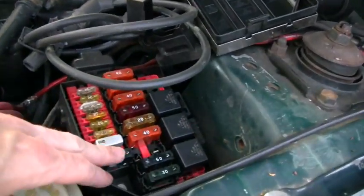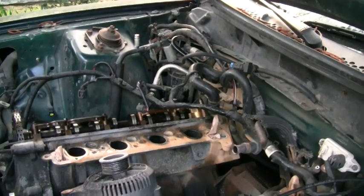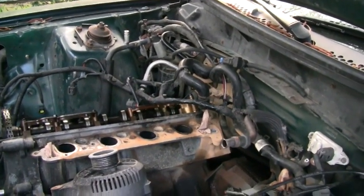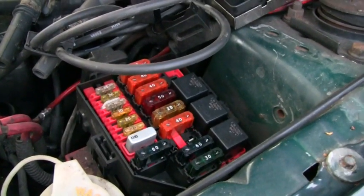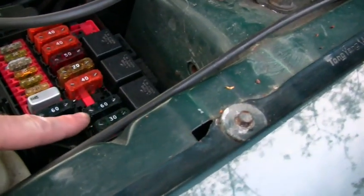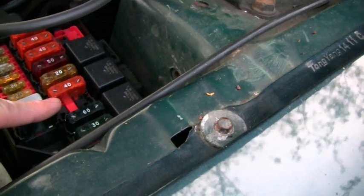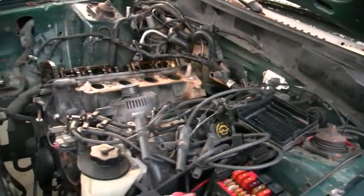The thing I've got to do is pull out the fuse for my fuel pump, because in pulling out the manifold I also disconnected the fuel lines. So if I were to leave that fuse in there, as soon as I turn the ignition on, fuel would come shooting out of those lines — and that's not good either. It's this third fuse up here. Just pulled that out. Now the fuel pump won't come on and we don't have to worry about fuel shooting out and lighting us on fire.